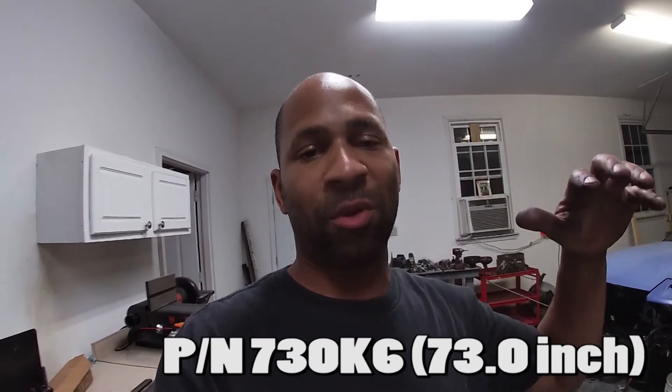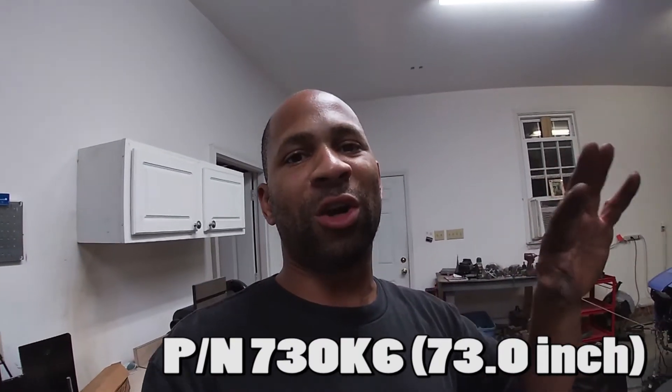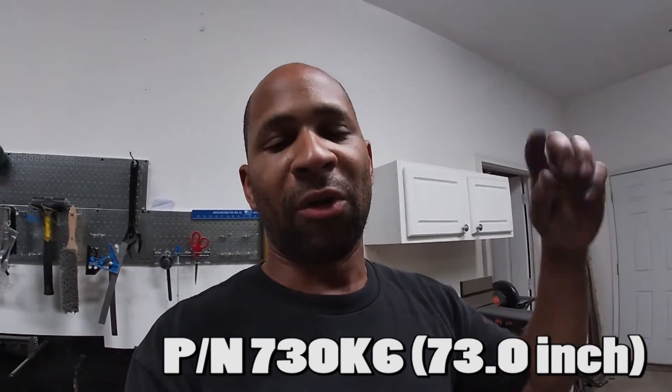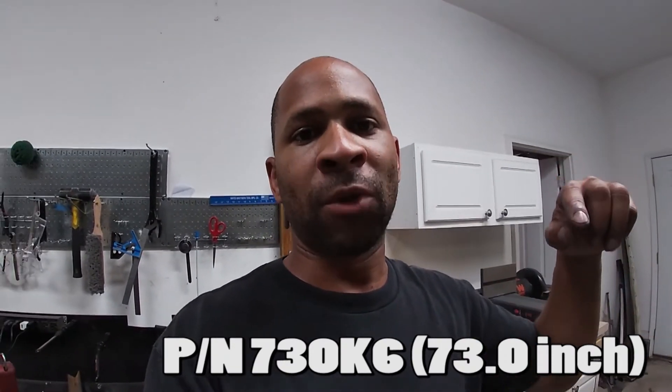All we need is a water pump, we do need the belt, and I'll put that belt part number at the bottom. I think it's determined by whether or not you're using the alternator I have, or if you're using a 140 or 160 amp alternator — I think they say you need about a half an inch longer belt on that part number I'm putting down below. I may end up going with that bigger alternator to be honest, because I've got a lot more electronics I'm adding on this thing. But in the meantime, that's it — that's how we install this accessory drive kit on our LS240. Thank you guys for watching, and we will see you on the next episode.